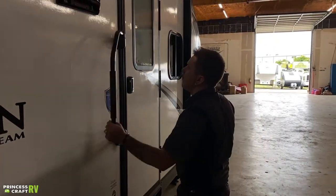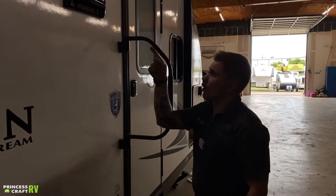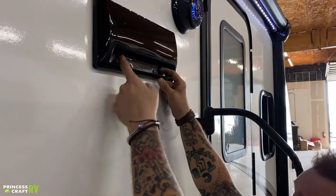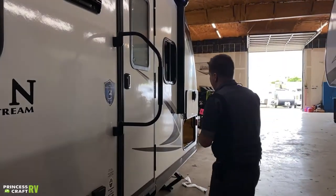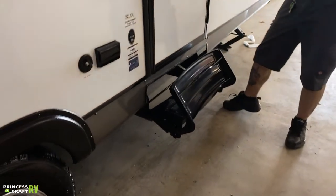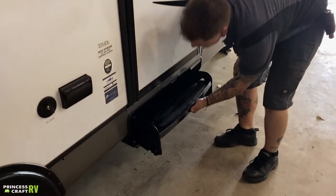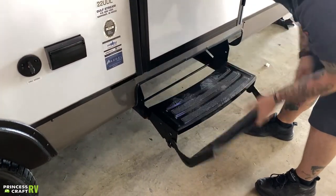The assist handle is up and over — some people like it against the door during travel. We have your hood vent here. It is very important to open this hood vent before cooking a meal and close it when you're done. This one is held in by friction and is very easy to open and close. Make sure you do that before making a meal and before going down the road — you want to allow it to exhaust, but you don't want weather getting in while traveling. Steps are up and in for travel; grab them and flip them down on the way out.